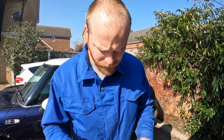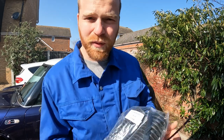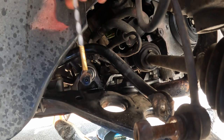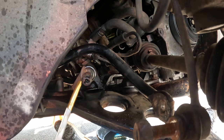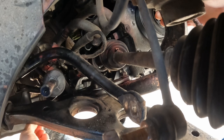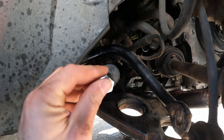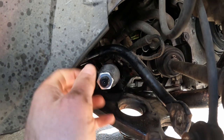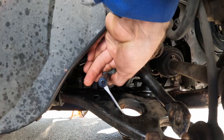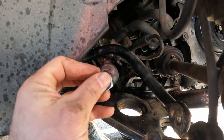I was about to crack on with that list of stuff yesterday but I realised I hadn't bought my missus a birthday card, so everything had to stop — life would not have been worth living if I'd forgotten the birthday card. So I went to pick up the boot for the inner tie rod. It came with two — I thought I was buying one, but I'm sure the spare will come in handy. First things first, let's put a little bit of anti-seize on this so the next person doesn't have the same issue I had, and then get on there with a zip tie.